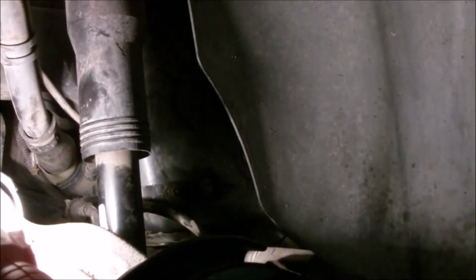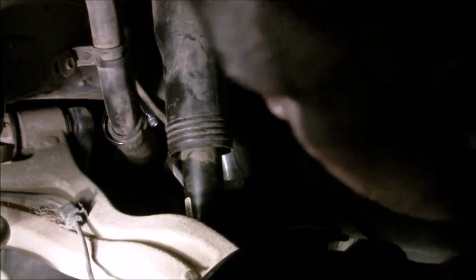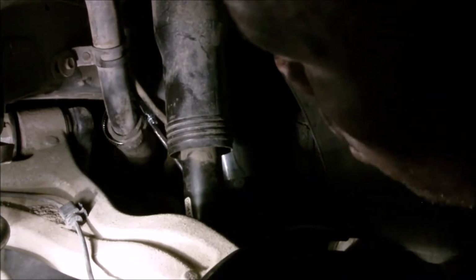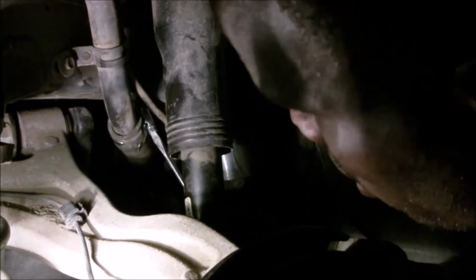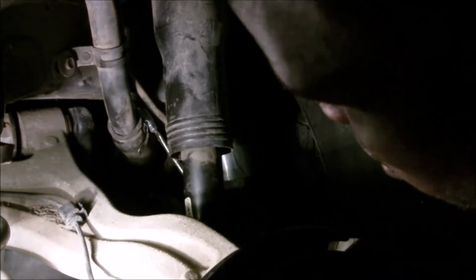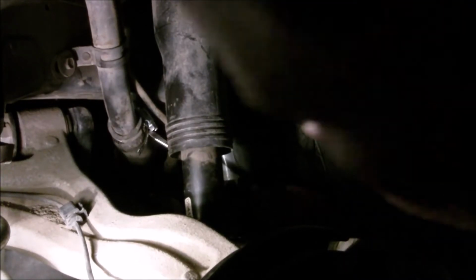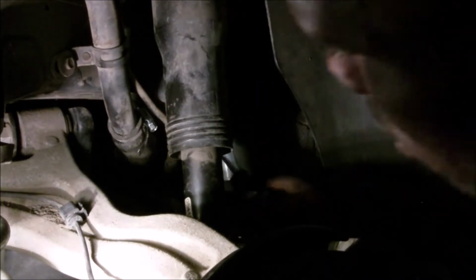And like I said in the first video, I mentioned that this hose clamp was broken on the filler neck right here, and so that was what you had to do. You get a hose clamp, and you got to open it, because it threads through the side of, there's like a cutout on the side of the hose, and it threads through there, and then you got to wrap it around and then reinsert it into itself and tighten it, of course.